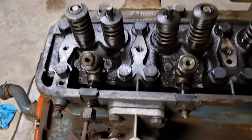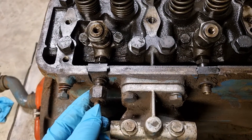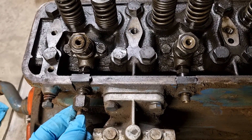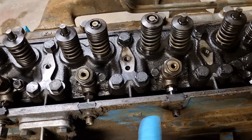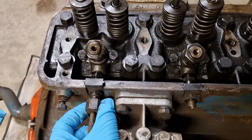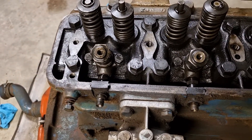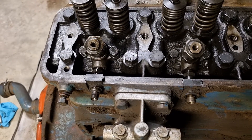Now the next thing you're going to want to do is remove the injector pipes. A big shout out to M Scheifel for commenting on my other videos to remind me to give this a wire brush and a pretty good clean — couldn't pressurize it already in the shed. So injector pipe off. If this was a running engine I'd be covering everything with painters tape to make sure to protect everything from dirt going in.